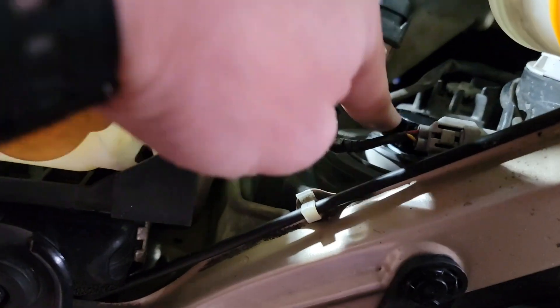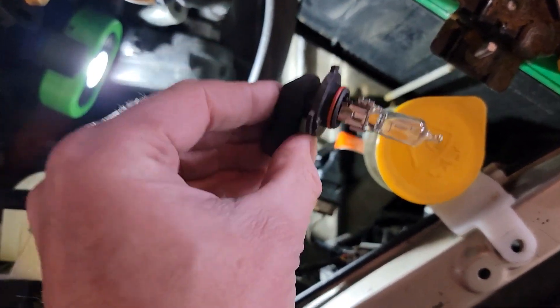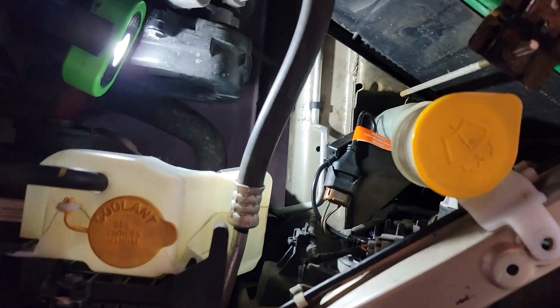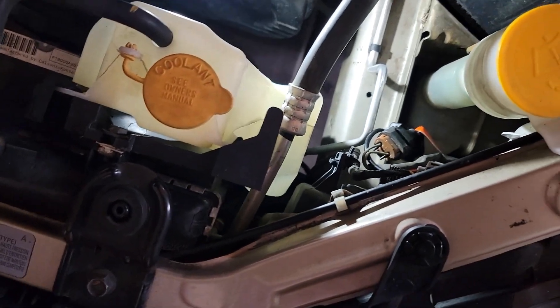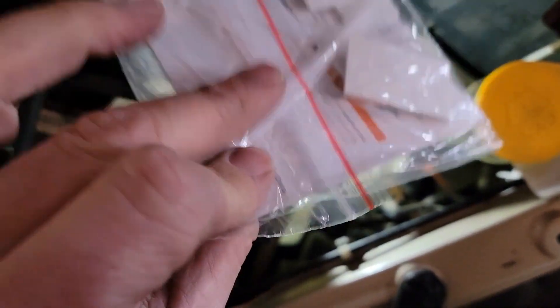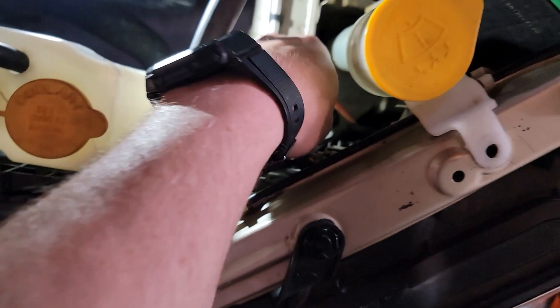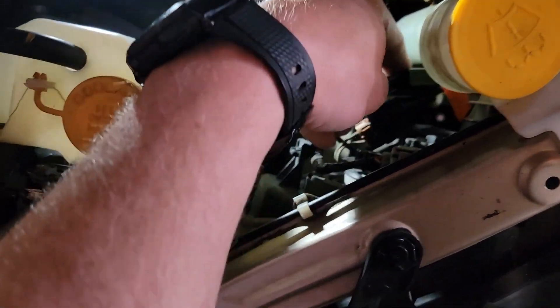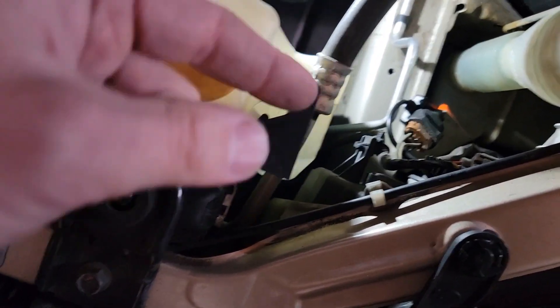This is the cooling fan — you don't want to damage it. The housing itself has three little tabs on there. The bulb is basically only going to go in one way and lock in one way, so you really can't screw that up. Each kit includes a warranty booklet, zip ties, and double-sided tape. Once it gets latched in there, you are good to go. That is the first bulb, the 9005. If you're worried about it rattling, you can zip tie it — just remember you'll have to cut that zip tie off later, so put it somewhere accessible.